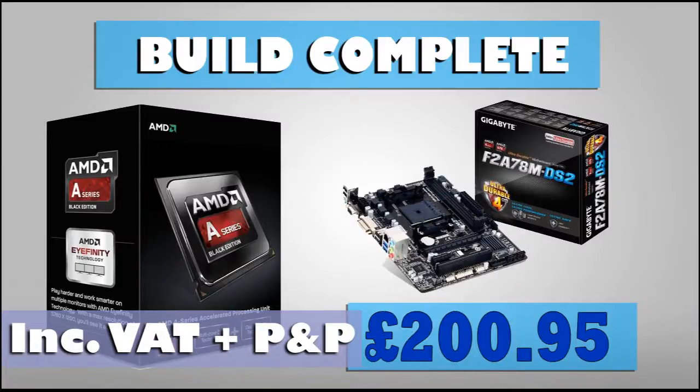That's the build completed. This costs £200.95 at the time of the video — I said under £200, maybe I'm rounding down. The best thing about this build is that lots of parts are still readily upgradeable. There's a 2.5 inch drive bay for an SSD, you can upgrade the hard drive, there's still a RAM slot to fill with an extra 4GB stick or even two 8GB sticks for 16GB total, and there's still a PCI Express slot for a future graphics card. Because the built-in power supply is 500 watts, you should have no problem providing the wattage required for an upgraded version of this PC.